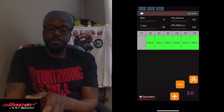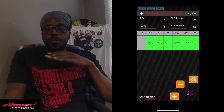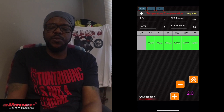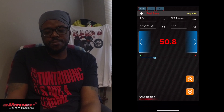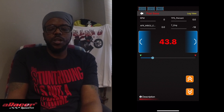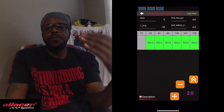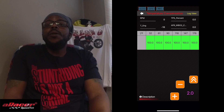As the temperature rises through these ranges, you're going to adjust the base here. How this works is: 100 is the base — the bottom line — to what we already previously set, so everything is changing off of that. Say if you put your base fuel at — with my big bore kit it's like 43 to 46, so we'll say 43. If I put it at 43, that's what this is starting from. That 100 is 43, and when you add fuel it goes up from there.